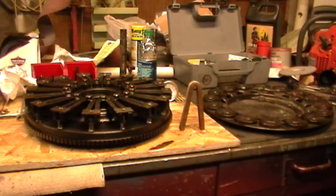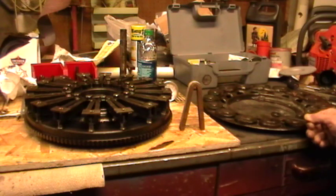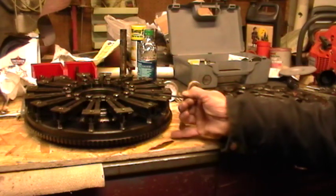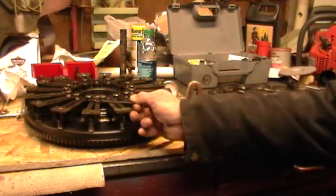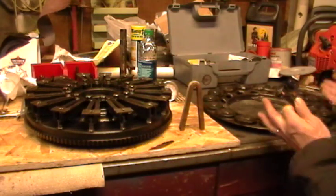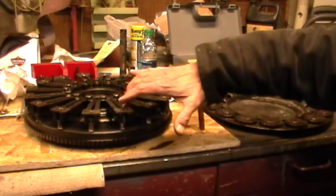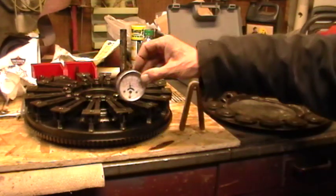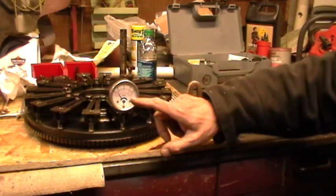Each contact has a polarity — this one we'll call blue, this one red; blue is north, red is south. The flywheel has the same situation: south, north, south, north. We'll flip it upside down and match south with north all the way around, then hook up a powerful battery charger and zap it to bring the magnetism up in each magnet. When we're done we'll gauge it again to see if we've increased it from 70 on up.